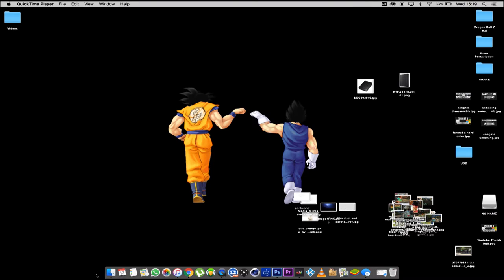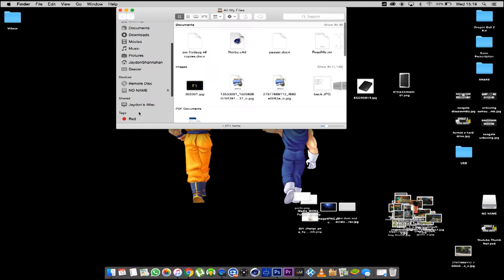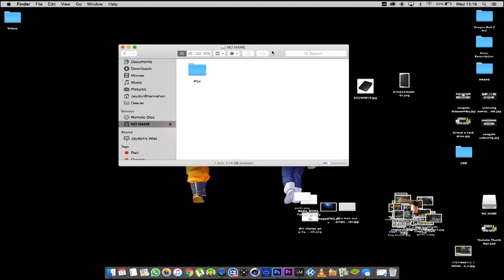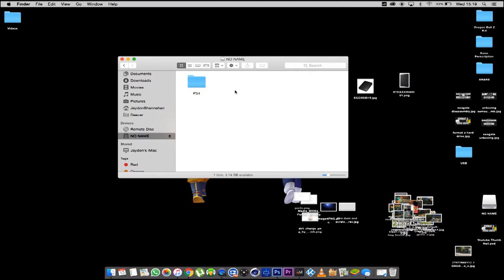Okay, so now what we're going to do, we're going to go into our Finder, and we're going to pop up the pen drive. So you need to insert your pen drive now, and this is where you download the PlayStation update file. When you put the new hard drive in, it will install the operating system for you on there. What you want to do is make a folder inside the USB. Just call it PS4. Inside of that, call it UPDATE, all in caps. Then go download this file or whatever the newest update is. I'll put a link in the description for you to go download that now. All you've got to do is download that, throw that in the update folder, and then you're done.